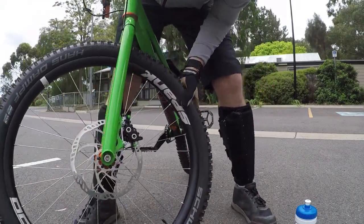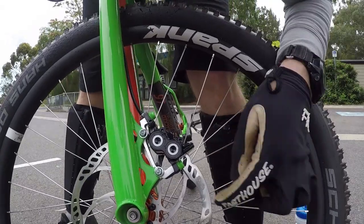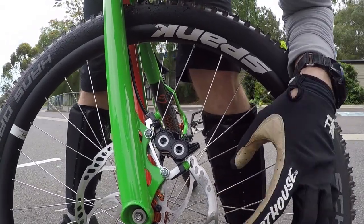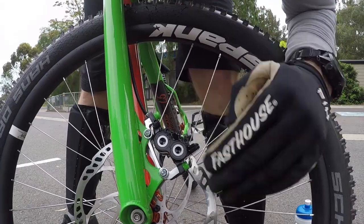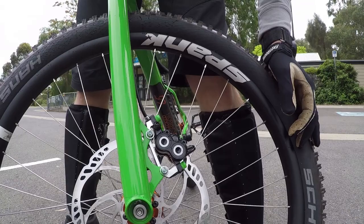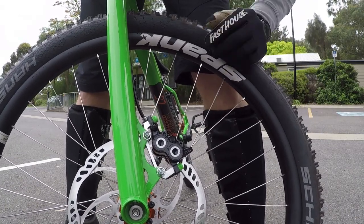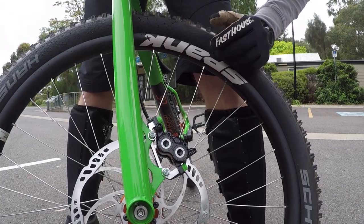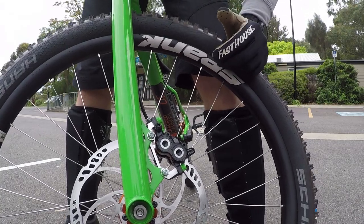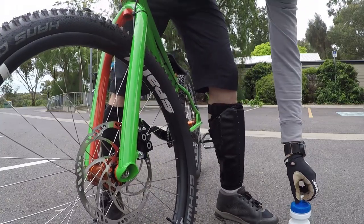That's starting to feel better already. If you give it a close look you can see the machining marks going one way, and we're trying to get that to all be nice and smooth for the braking surface between the rotor and the pads. The smoother it is, the harder the pads bite in, the better the braking performance — fairly important on a trials bike as you can imagine. I'll keep at it for a bit and then we'll move on to the rear.